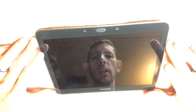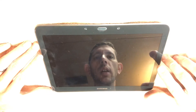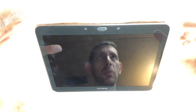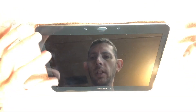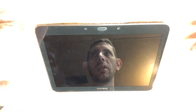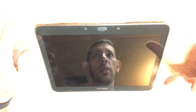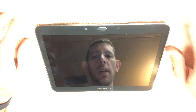I read online that when you get that 'battery temperature too low' error, the issue is the charging port — like the little ribbon cable in the charging port — there's something wrong with it, it got water in it or whatever. We've had this tablet for several years, so I ordered a new one and I think it was eight or nine bucks on Amazon. Put it in, it worked for like a day and then stopped working again.